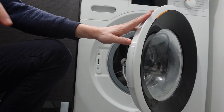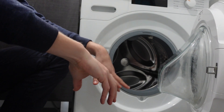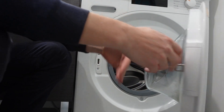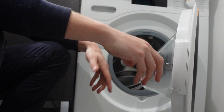So what is this error? This error is basically a heating error, a water heating error. There could be two causes to this: one, the water could be failing to heat up, or two, it could be a sensor error that's not sensing the water temperature properly. As you can tell, it could be two different things and they're really things that you need a technician for.